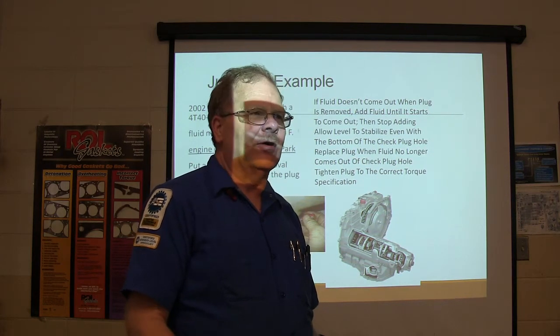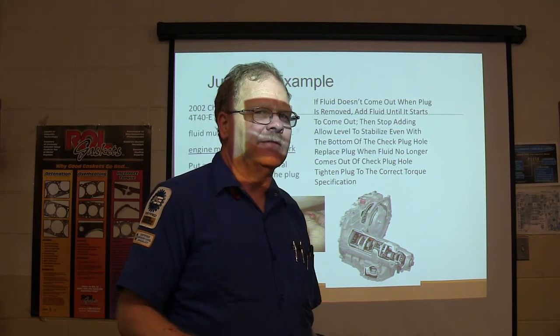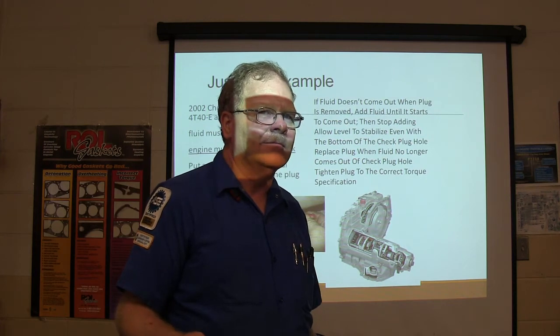And he put it back in there, and the car ran like a new car. It was just too full of fluid. And like I tell you, most of the time when a transmission is too full of fluid, it pukes it out in the vent, makes a big mess.